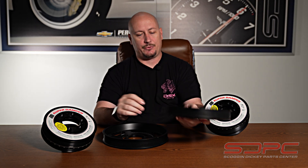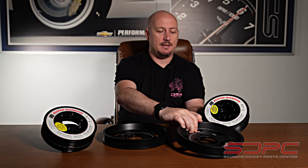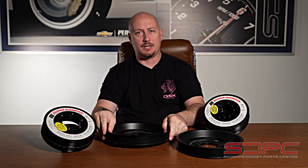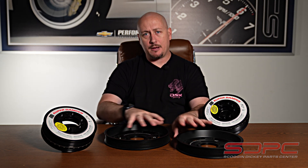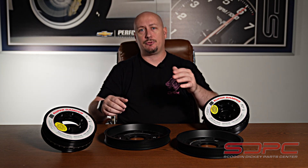This is really nice because you can start with your 9.06 inch pulley and then six months later, if you're jonesing for a little bit more power, you can move to the larger ones — especially if you're still not wanting to crack open the blower or do any porting services. One of the things you need to consider when going up in lower pulley sizes is that you have other pulleys around that crank pulley: other parts of the accessory drive, tensioners, AC pulleys, and everything else that you're going to have to be mindful of. A lot of companies will have information on whether you need a relocation bracket for your tensioner, or if you'll need to notch brackets or remove something. It really depends on the blower, the pulley size you go with, as well as the engine combination you have.